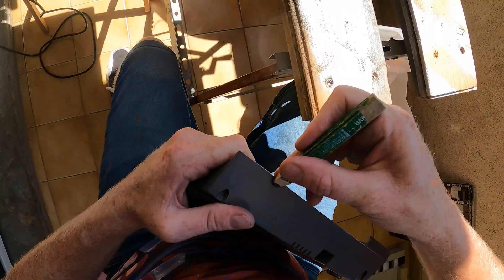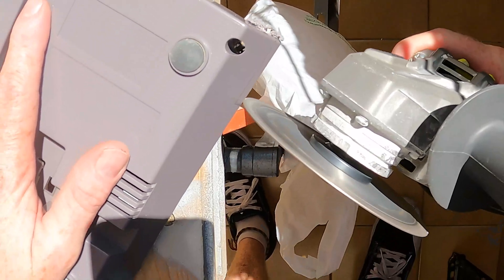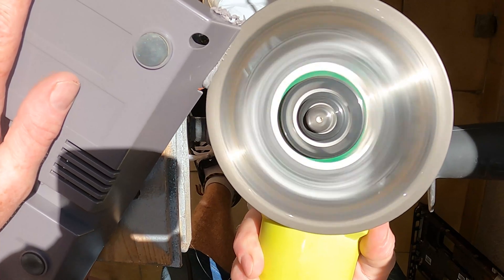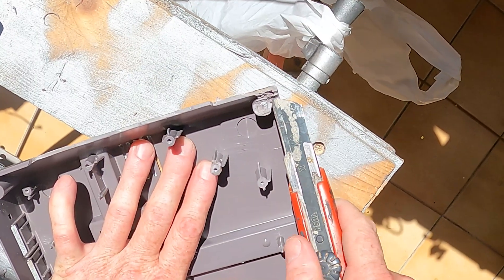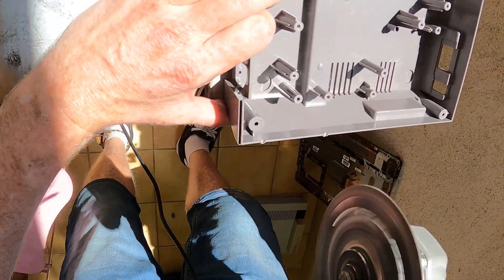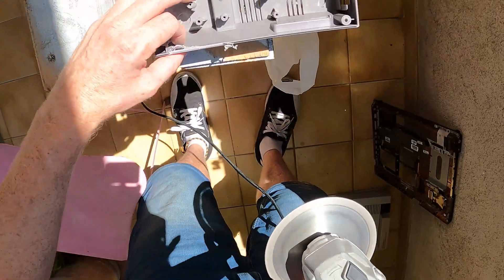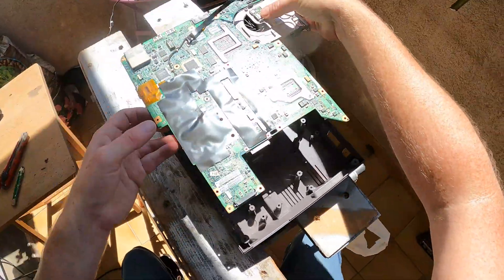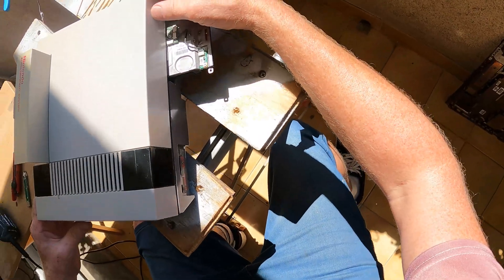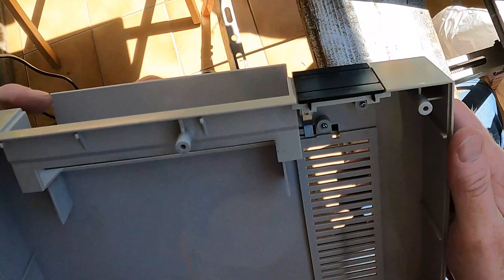If we take that all the way down and chop that right out, this will allow for much better airflow on the GPU side of the cooler. Grinders can be kind of scary and dangerous — a Dremel is a much safer option. But one way you can get used to a grinder is to practice on some scrap bits. That's pretty good. We just need to notch the back and the card reader — we're going to have to flatten all that off.